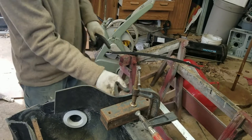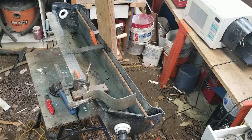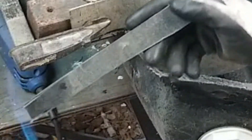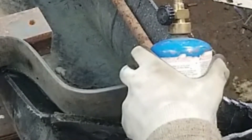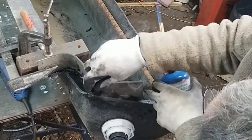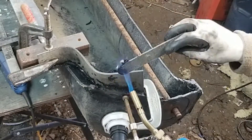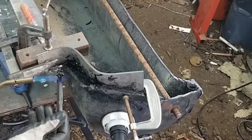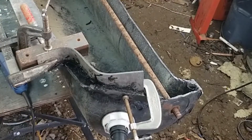So I'm just going to tack weld it here. To weld it in here, I'm going to get a broad flame going and set some plastic on fire. Once this is tacked on enough to hold itself, I can go back and fill the gaps. Once plastic catches fire it will burn until it's all evaporated — see how it's dripping. I want to get that dripping fire in here while it's molten, because if it's molten it'll stick to both sides and become like a glue.